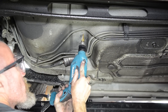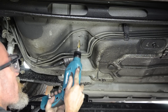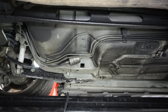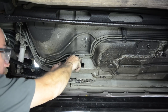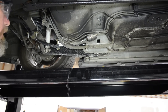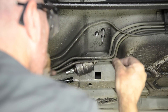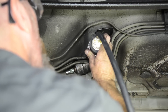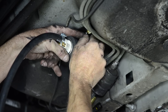Now onto the rear of the car. First you're going to move the rear seat from the driver's side, then we're going to drill three holes after we've marked them with the bracket for our auxiliary fuel pump. We're going to drop the three bolts down from the top. Next we're going to remove the fuel line from our fuel filter. Remember the fuel system is under significant pressure, so make sure you relieve that pressure with the Schrader valve up front before you remove the filter. It's not uncommon for quite a bit of fuel to leak out, so make sure you have a bucket handy. Now we're going to install some isolators on the bolts for the fuel pump — this keeps the fuel pump from making noise and transferring that sound into the passenger compartment. Next we install the fuel pump with the bracket and tighten our bolts.